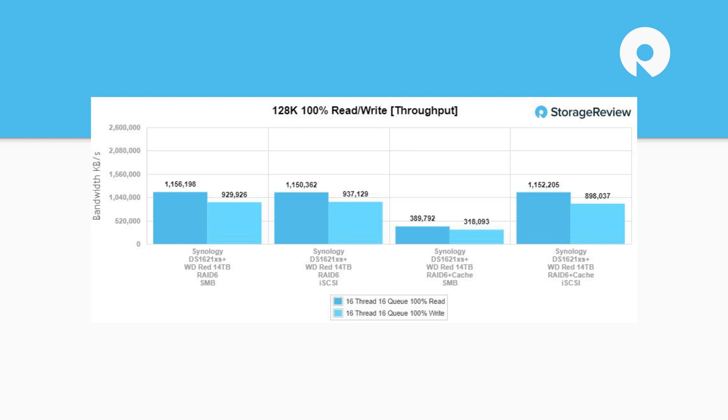In large block sequential workloads, you're not going to find a huge benefit from cache. Actually, adding it into the mix will end up making things a little bit slower on the Synology side. By default it passes through sequential IO, which we'll look at in DSM in a bit. You're going to roughly saturate 10 gig — this is tested over a single 10 gig connection. You might eke out a little more if you're using all the ports, and in some scenarios you might use 1 gig for management and push aggregated traffic over the 10 gig connection.